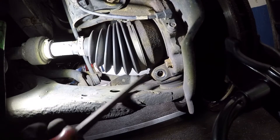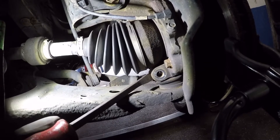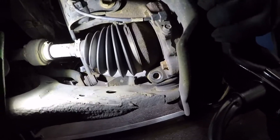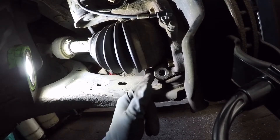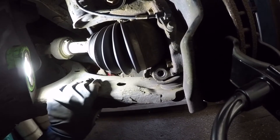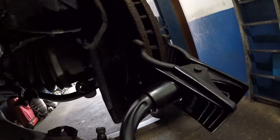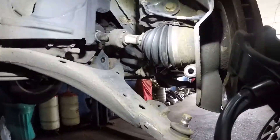Next I'm gonna try to open up that groove back there slowly. If you need to, you can grab the spindle and turn everything — turn the whole steering so that thing faces towards you. You probably don't even have to open it, you can try to hit it. There you go — the control arm is just hanging there.